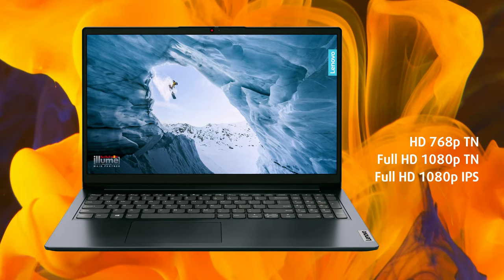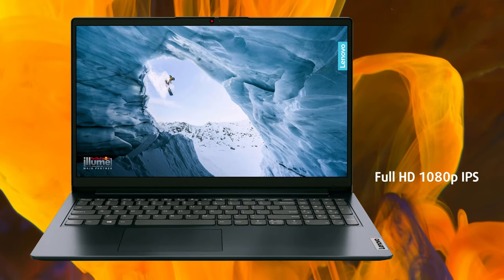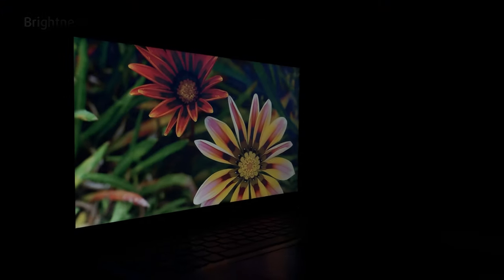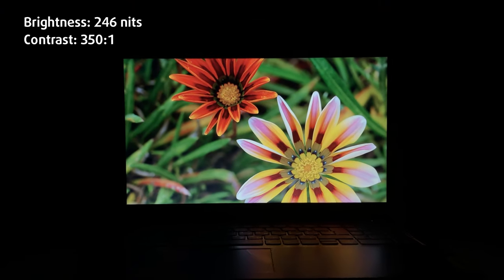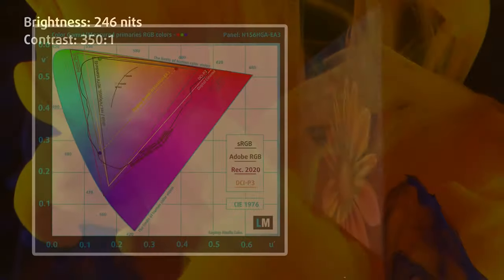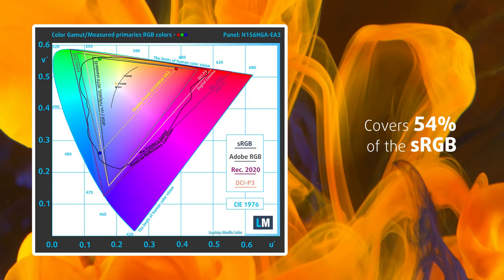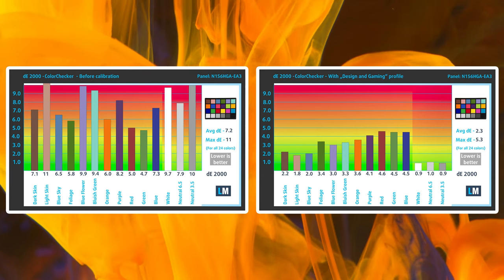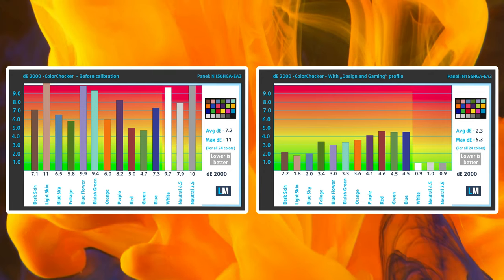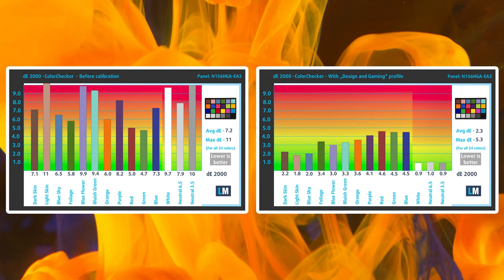The display selection includes both TN and IPS displays, however, we can't recommend the former, as the poor viewing angles and low brightness don't equate to a good experience. We would go for an IPS option, which should honestly be in the base configuration, but we know that Lenovo has to cut corners here and there. The panel covers only 54% of the sRGB color gamut, which isn't enough, but our design and gaming profile improves the accuracy by a lot, lowering the delta E value from 7.2 to 2.3. You can check out the design and gaming profile, along with our other ones in the description below.